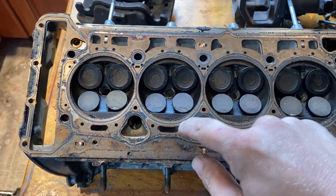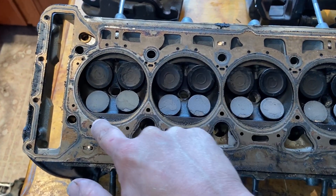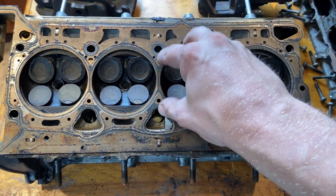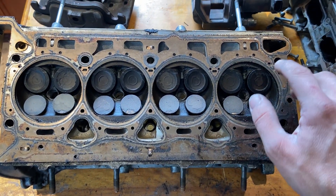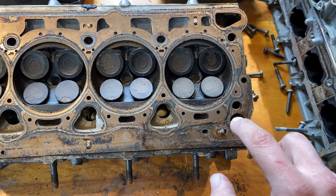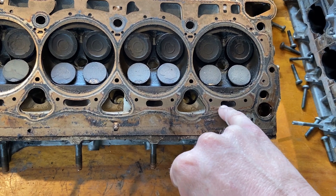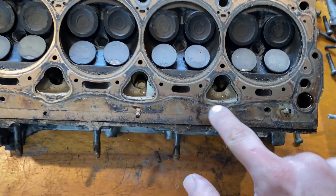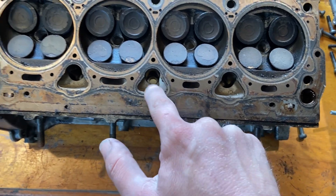What we have pressurized is all these individual rings right here — the compression has to stay inside these cylinders, so this stays separate. These oil galleys stay separate. Oil comes out through here, comes out through here. And then the coolant is going to come through that small hole, that larger hole, that smaller hole — it's going to come out through here. You see how there's gasket surface right around here — that's what separates the oil from the coolant.